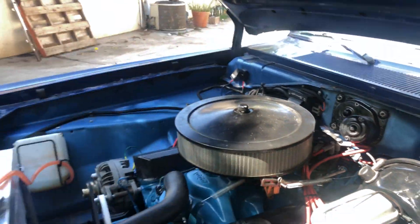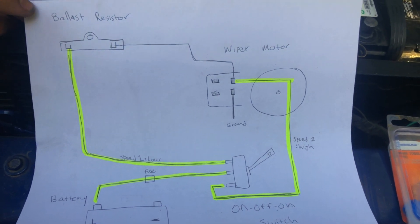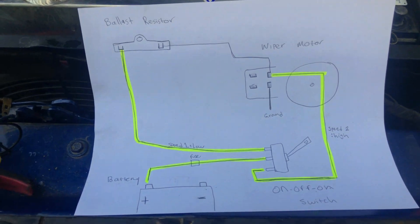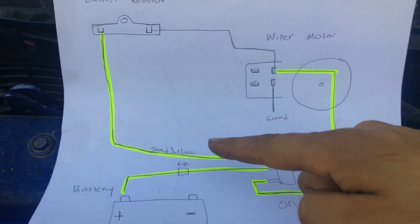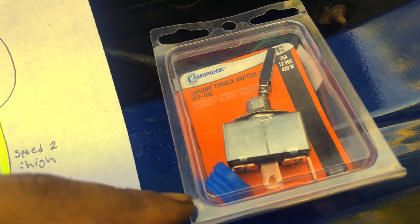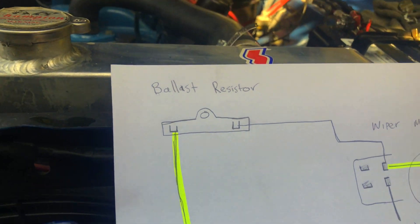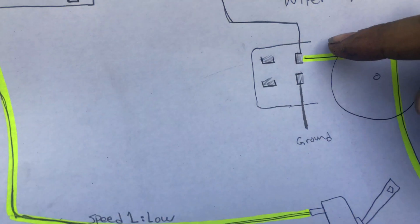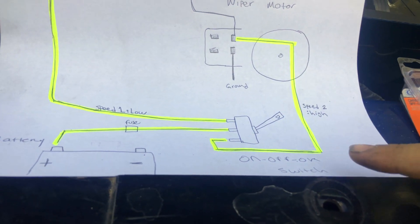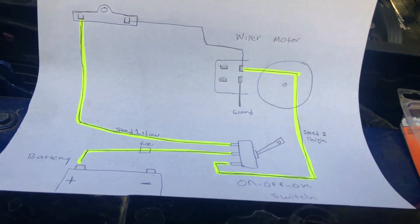Here's the diagram I wrote out for you guys. If I were to not use the ballast resistor, it would technically be a one-speed wiper motor. The way it gets its second speed — the slower speed — is through the ballast resistor, because it reduces the amount of volts the wiper gets. For the low speed, I'm putting a wire from one end of the ballast resistor going to one of the on positions on the toggle switch. I'm also running a wire from the other end of the ballast resistor down to the wiper motor pin that receives the 12 volts, and from there a wire goes directly to the other on position on the toggle switch, which gives the high speed.